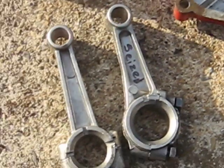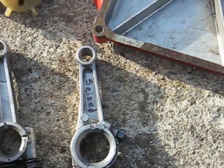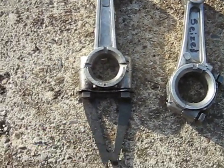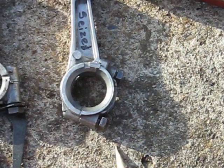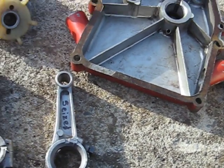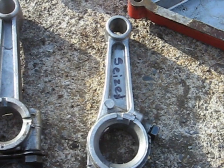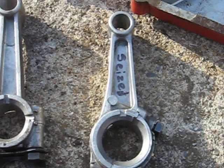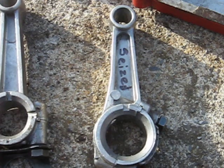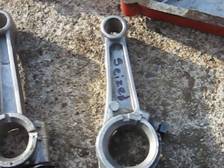The other thing is the oil dippers. I have two connecting rods here — this is a stock lawnmower connecting rod. This isn't a three horse or three and a half; this is a two horse, so the dipper's a slightly different shape. But you'll have to get a dipper that fits. I believe one would fit from a model 80202, type 220901, code 91100303. Basically, any dipper from a model 80202 rig should fit your three and a half horse crankshaft.